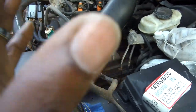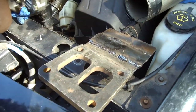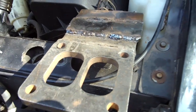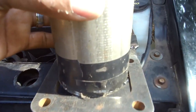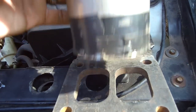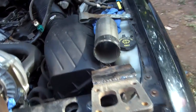I got the wire started and everything is good, but I'm not going to install this harness just yet because I've got a lot more small things to deal with - like this turbo situation. On this inlet it's going to be a situation: this is a three-inch pipe, but this opening looks more like a four-inch. If you sandwich it down it doesn't quite fit the build. You can tack-weld it and make it work, but I need something a little more close, so that's on hold.